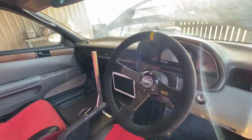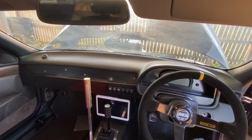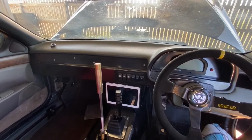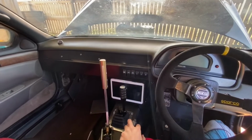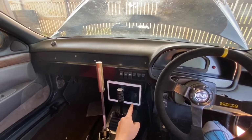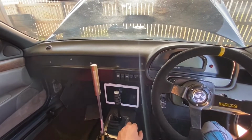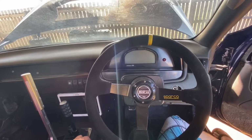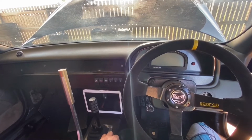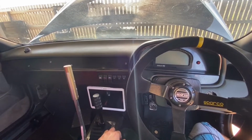Alright, so 5-speed manual conversion obviously. And custom lower section of the dash, so all the top's stock dash, and then aluminium parts made up for the bottom of it, so it looks pretty snazzy and tidies it up. Completely empty behind the dash apart from wiring for miscellaneous things. Switch panel, tablet there which runs off a Bluetooth adapter off of the Haltech, so we can show all the crazy little things that we don't necessarily want on the IQ3 dash there. Like, I think I've used it before for throttle position and all those sorts of things that are good just for troubleshooting, and can do all data logging through the apps and everything on there as well, so that's pretty cool.